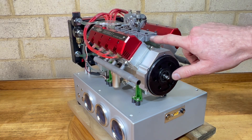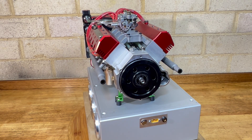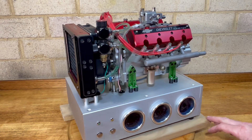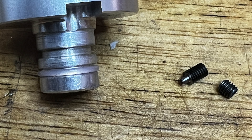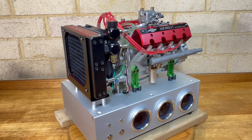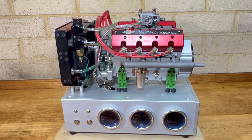The engine itself — the bottom end was assembled, but I just had to finish machining the piece at the top here, the intake manifold, to make sure it was all flat so it sealed properly. The little distributor — I machined a little groove in that so the little grub screw had something to locate in and it wouldn't keep popping out, and I'm able to adjust it.